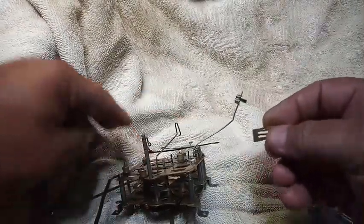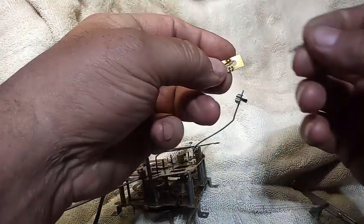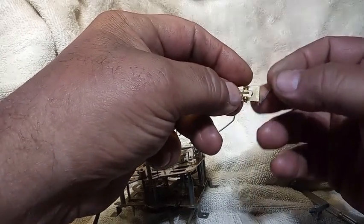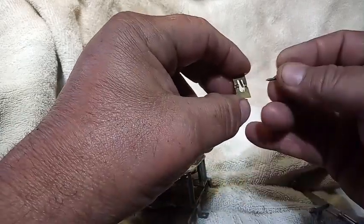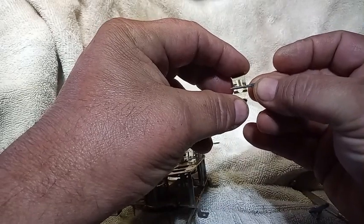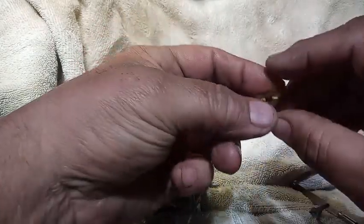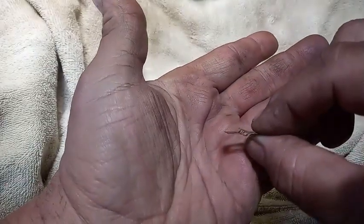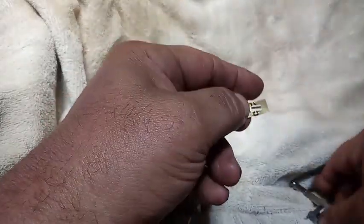So we got the governor fan, and again, it's too loose. And they make these things differently, okay? And so the easiest way is to take the shaft off the fan. And then you see how that is sticking up. You want to push it down.